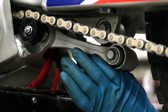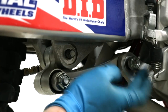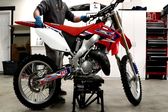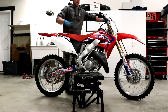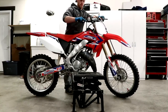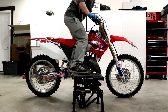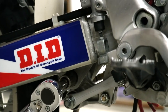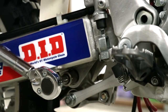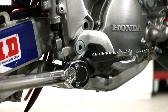You're going to have to pull up on the swing arm and wiggle things around to get these bolts into place. Now we're going to thread the nuts back on, but don't tighten them down all the way or torque them quite yet. Here's a little trick: take the bike off the stand and compress the suspension — this will line things up and settle everything in. Having the linkage bolts loose allows for this to happen. When you torque the linkage bolts, leave the bike off the stand. When you're riding the bike, the suspension is under the weight of the bike, so it only makes sense to torque the linkage bolts when the bike is on the ground.